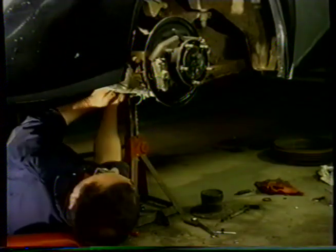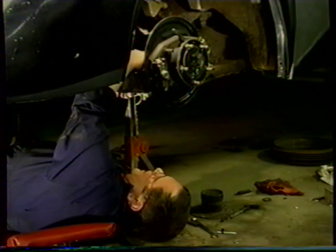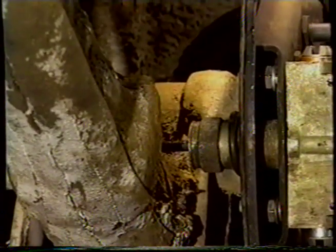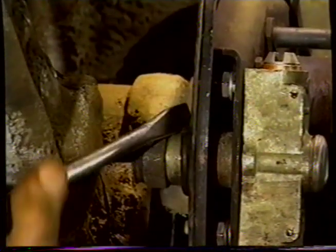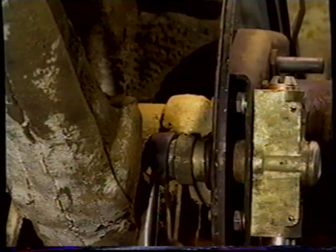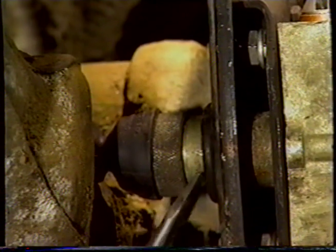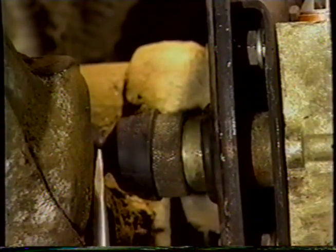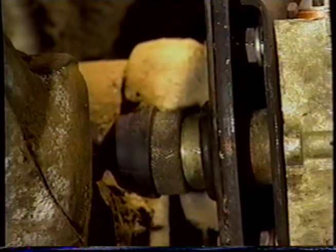So we're going to put the rubber seals onto the rod, or onto the expander and the rod. You have to work past the gaiter. There's a groove on the expander at that point. Now we'll take our rubber cover. So we've got the water excluder in the groove on the expander, and we've got the rubber cover, the rod water excluder, into the groove on the knurled nut.